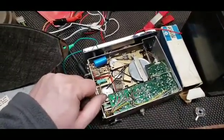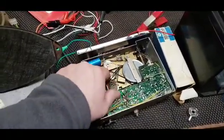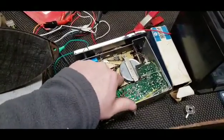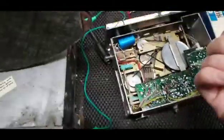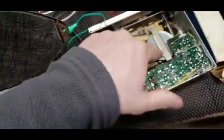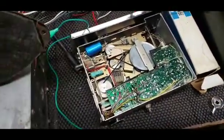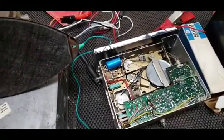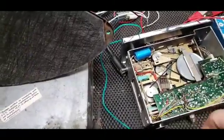And my guess is they must have just burned up, like they must have dry rotted, and somebody tried playing it, and they just melted into these pulleys. You could still see the residue on my fingers and underneath my fingernail. I cleaned my hands, but it was just a lot of black, and bits and pieces of the belt were stuck in that groove. So the belt wasn't even really able to fully seat in these pulleys here. And there's two grooves in this one.